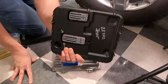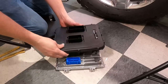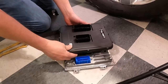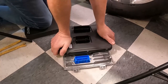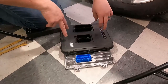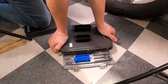You want to line up the main connectors with those connectors, making sure you find the connector itself. Don't roll it on or you'll break or bend a pin. Once you get it on, apply force straight and even. As long as you're applying pressure evenly on the Pulsar you won't break anything, and you'll be fully seated on the PCM.